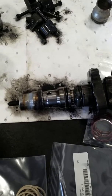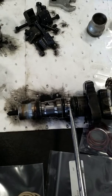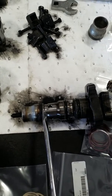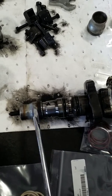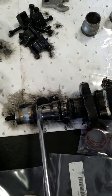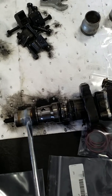You've got nothing on your engine oil. So you got two o-rings — one here and one here — and this keeps the oil in this area. From here to here you got diesel fuel, so you got an o-ring here and an o-ring here that keeps the fuel in this area. But the cap has two seals, and if those two seals go bad, there's fuel pressure on this area and it pressurizes the system.